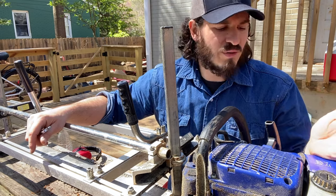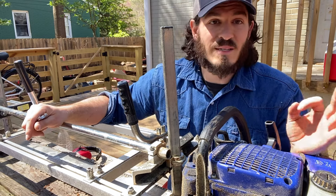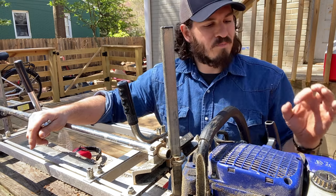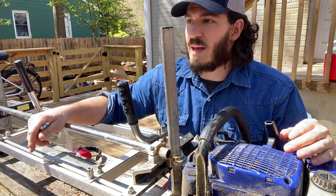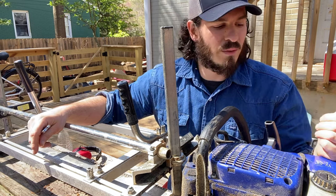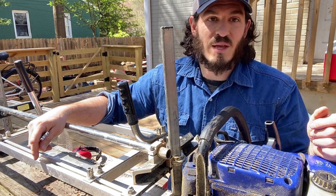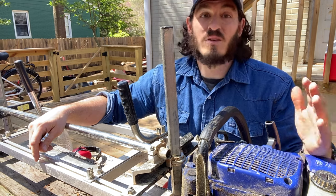That's something that you do, but it was really early, and the filter I just didn't feel ever gave the saw enough air. My spark plug blew out of the cylinder head, and I actually purchased a new cylinder head for it, but I was right in the middle of the job when it blew, and so I threw a Save-A-Thread in there. I had to tear off some fins, and so that was a whole big deal.